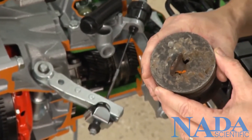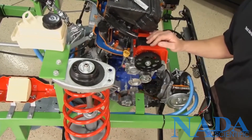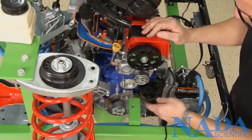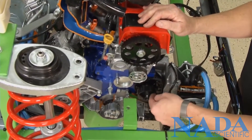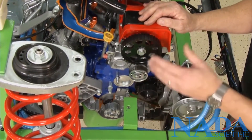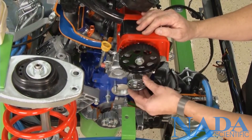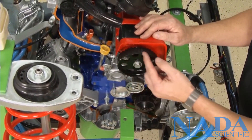Well, we cut that belt so we need to head over and time this engine. Because we cut the belt off, we need to retime this engine. But before we do, I'll show you a few components that the timing belt runs. Down here is the crankshaft, and from there it comes up to the water pump — we said earlier it may drive the water pump, and on this model it does. With all the work of taking these components off the front, go ahead and change the water pump out while you're down there. Then it comes up through a tensioner — this is a manual tensioner — and then it drives the actual camshaft right here.